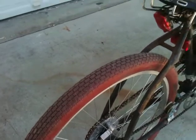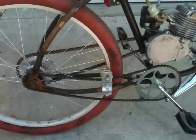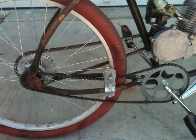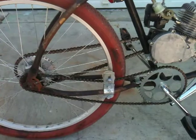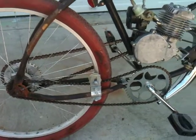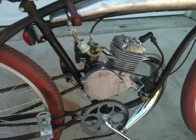Put the chain adjuster on the pedal side, which you barely ever use, rather than having it spinning all the time on the motor side — which is what most people do.